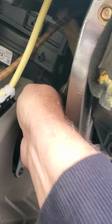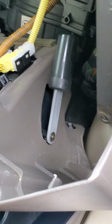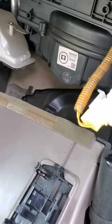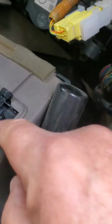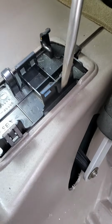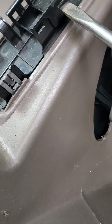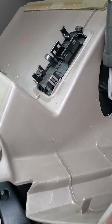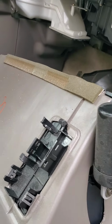This is the cylinder I was talking about, but that's part of the glove box, so I don't have to worry about that. I think once I get this wiring harness off here, the whole glove box should come out of the way. So that's just held in by a clip over here. If you put a flat screwdriver down in here and pry it just a little bit, it looks like there's 2 clips, one there, one there. And the glove box just pops out of the way. And, oh, there's a part on the bottom too, but it came out along with it.